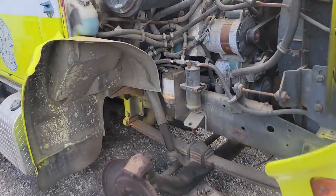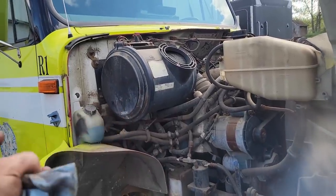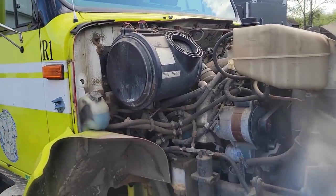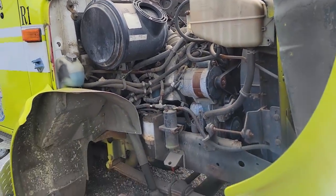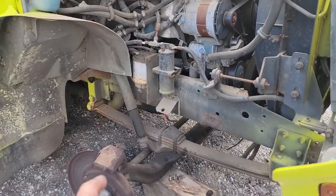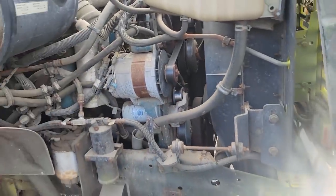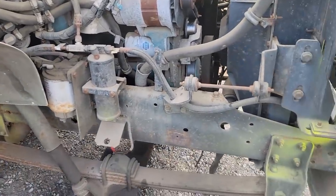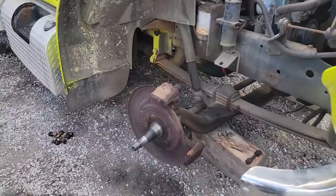The problem was the transmission controller push button wouldn't light up - he found that on his own, it was a real simple fix in the battery box, so that worked out well. But the brakes were a problem: the driver's side front and driver's side rear were locked up and in pretty rough shape. He asked me if I'd be interested in doing the work.